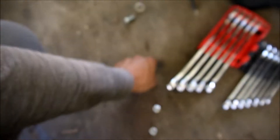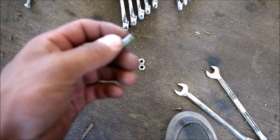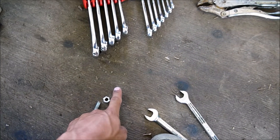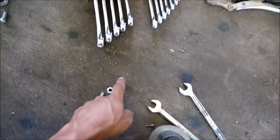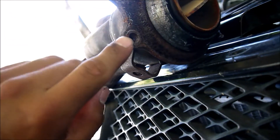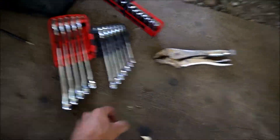I got the broken bolt out. What I did was I used two nuts — I locked them together onto the small piece sticking out, then turned the bottom one like a normal bolt and it came out. Instead of vice grips, that method worked a lot better. I did still mess up the thread though, so I have to go get a tap and die to fix that. I still have these two nuts which should fit the new bolts since they came out of the same package.